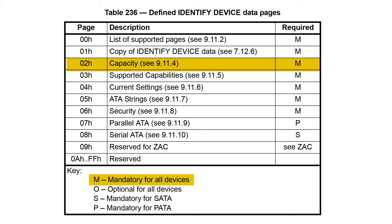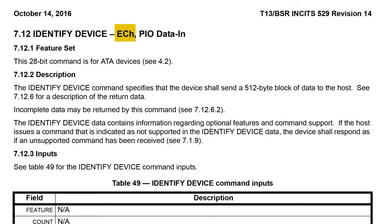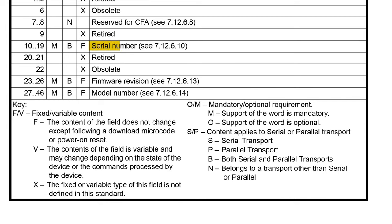It's like taking your car to a petrol station to fill up with 52 liters of fuel, but the gas station owner changes the reading on the pump so you get about 7% less fuel than the number shown. And not only that, but when you're not looking, someone goes underneath your car to change the gauges, so when you get back in you see a false reading from the instrument cluster making you believe you got 7% more. Based on ATA protocol command set, the command to request the device to identify itself is EC. Once the EC command is issued, one of the pieces of information reported is the SSD's serial number set by the SSD manufacturer. We know the drive has no customized firmware and drive identification is common and mandatory for all ATA devices.